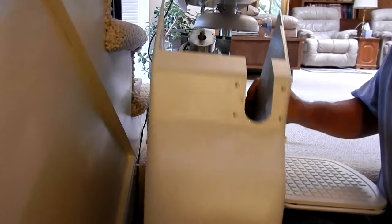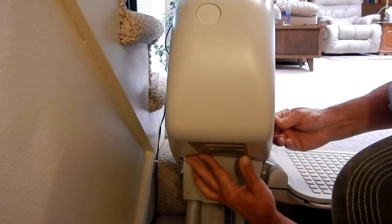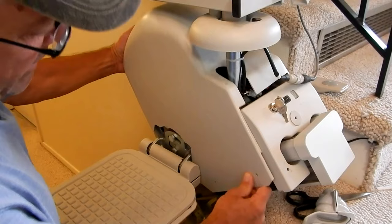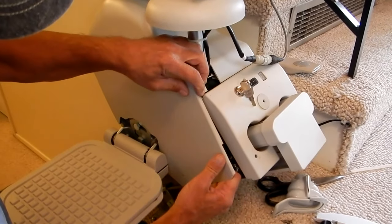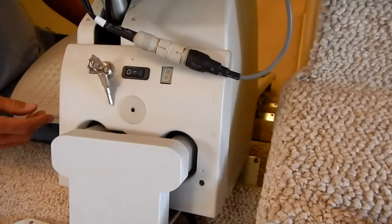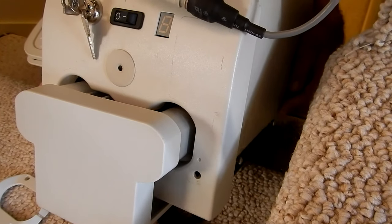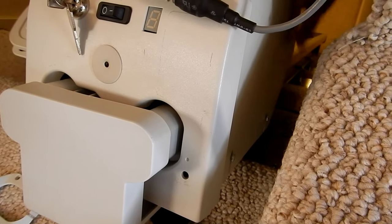Let's get our cover back on. Start by placing it over the unit, then push up a little bit on the back to get it over the lower limiter switch. Now work it down to where we can get it inside of the front limiter switch cover - get it up to this corner, just bend it around a little bit and it should slip right underneath there. Now that we have the cover inside of the limiter switch cover, pull it back up and engage these slotted screws. Work it back down to engage those screws, then slide it back down.